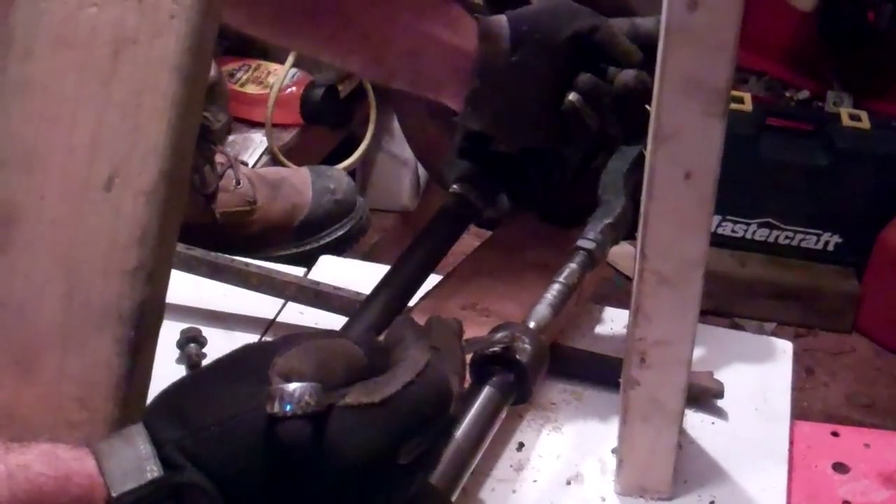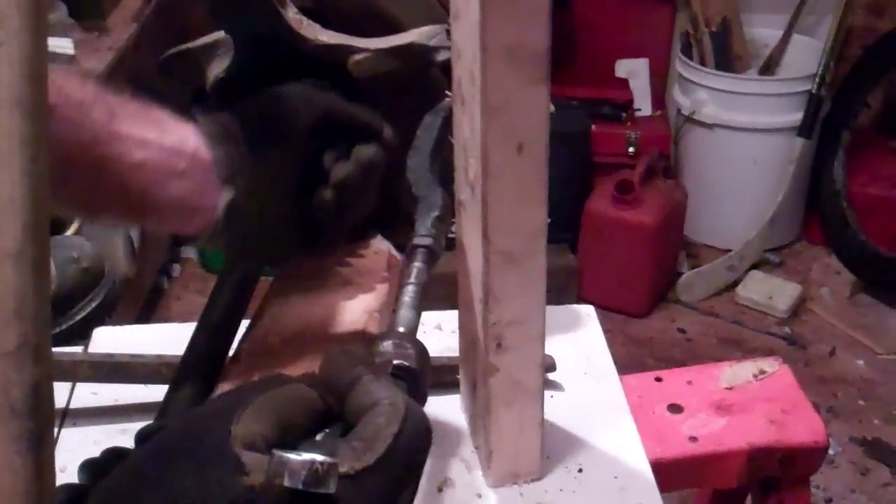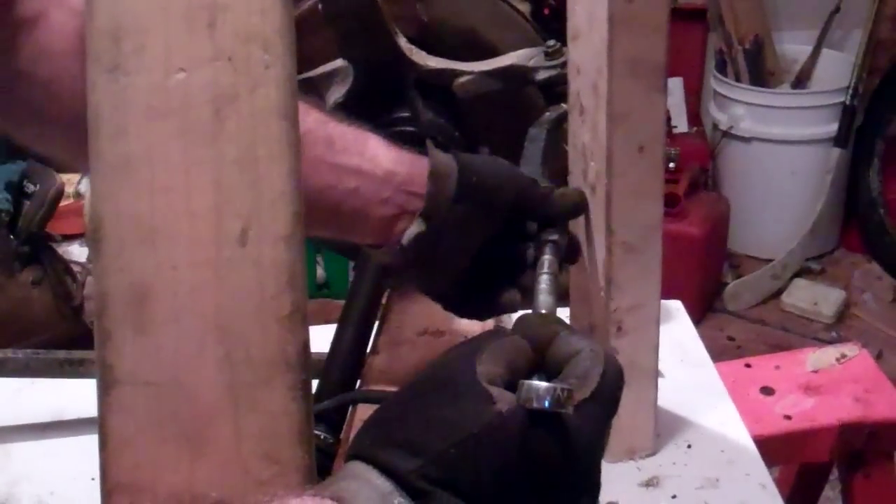My videographer is doing a fine job getting in there and showing what we're talking about. Here's the inner tie rod end, there's our outer tie rod end. For a wheel alignment, what we want to be able to do is change that distance. This is threaded so we can change the distance there. If it wasn't for the fact that we're able to spin this, you'd actually have to take this tie rod end off and spin it around to change that distance. But here's the slick part of it — you go into your mechanic, he's going to do an alignment. We're talking toe here, which is the distance from there to there, and that's really the most critical part of an alignment.